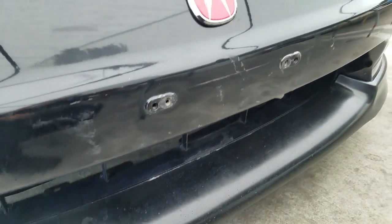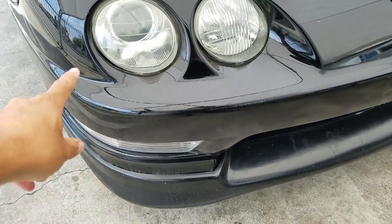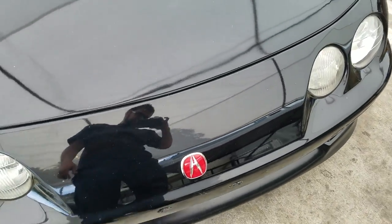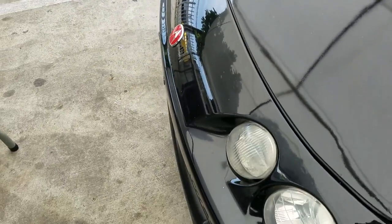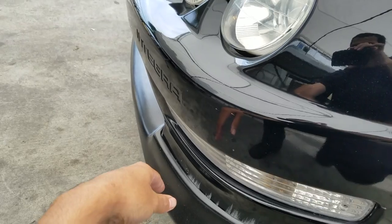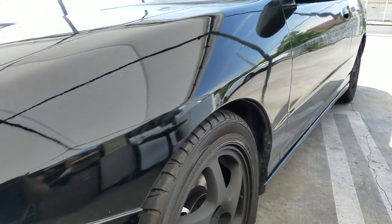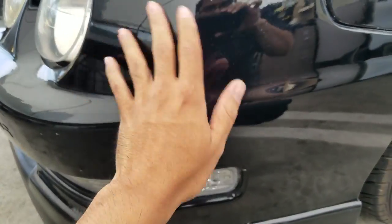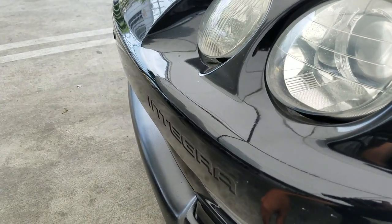So I'm gonna make this a little bit better. My first step is actually gonna be to wash this with dishwashing soap and make sure all of the wax, sealant, and everything is off. The last thing you want to do is sand and repaint something when it's loaded with sealant. That's how you maintain a good finish and gloss, but first step is gonna be to clean it.